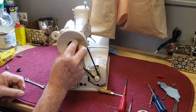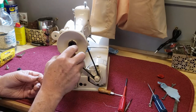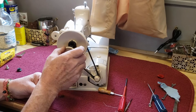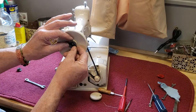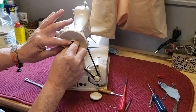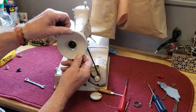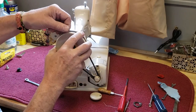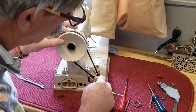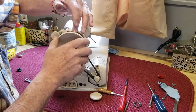When you're putting it back together, if your stop screw is landing on one of these nubs when your clutch knob is tightened down all the way, then you have to turn it over. Right now the nose is pointing up. I'm going to turn it over so that the nose points down and the two ears point up. Once the clutch knob and washer are off, your hand wheel will just screw off. If you hold the belt to one side as you turn this, it will just roll right off.